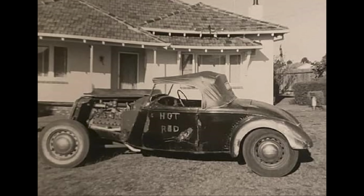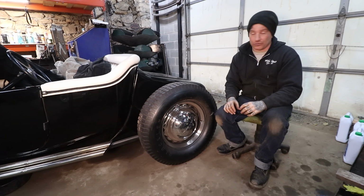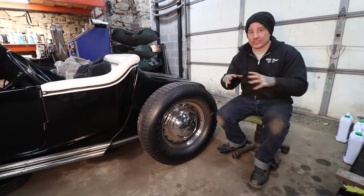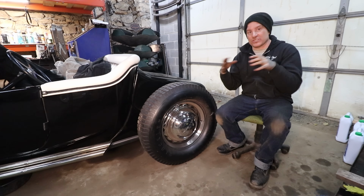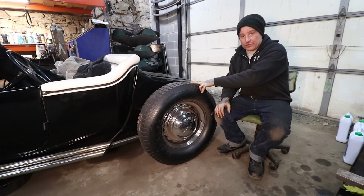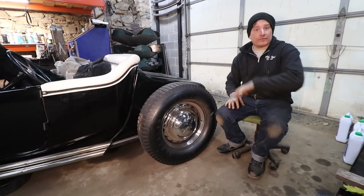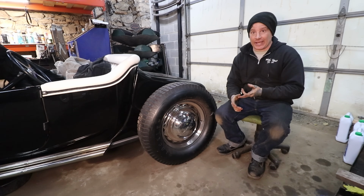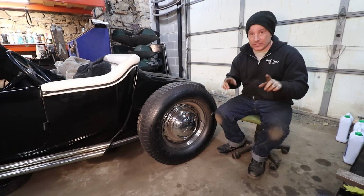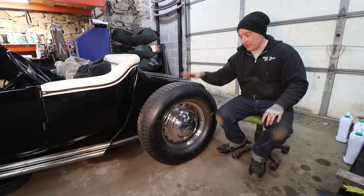Now, when you're getting into other brands of artillery wheels, those caps are usually specific to the brand of wheel. So if you're using a Dodge artillery wheel, a lot of times they have a smaller, almost like dog dish, like the wire wheels Ford had, and Chevy, et cetera, they have to use their own caps. But when it came to the early Ford wheels, there were a lot of different options you could use. But pretty much the rule of thumb is if it's a Ford wheel that's a wide 5 artillery wheel, the cap will fit across the board. All of those hubcaps will fit, whether it's the spider caps, whether it's the factory hubcaps. If you find the correct caps that are the single bar flippers, those will also fit. You just have to look at the inside mounting dimensions on those. Those are different because these have little clips that actually hold it in, and the inside diameter is different between 40 Ford and also the wide 5 wheel.